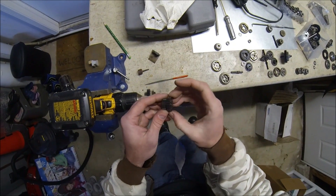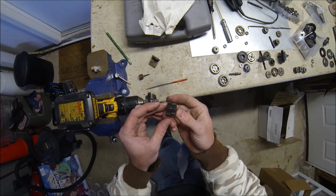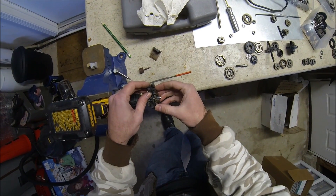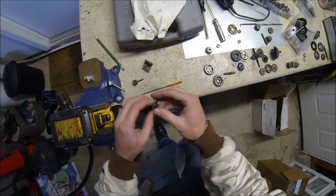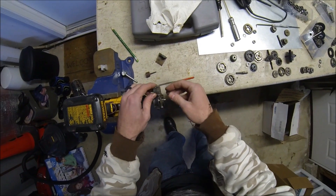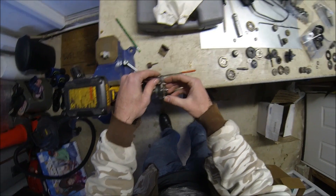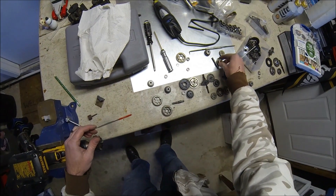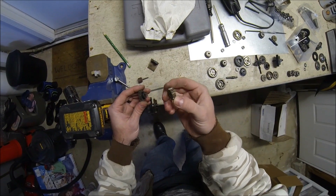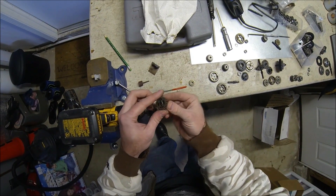Here is the HD version of the 1823 gear that you can get for the Flux — it'll work, but the problem is the gear mesh is too much. You've got the standard 1823 right here — it's the same thing, it'll work, but gear mesh is too much. So what you have here is the 18-tooth from the 3-speed and the 24-tooth.